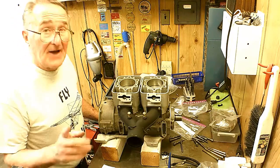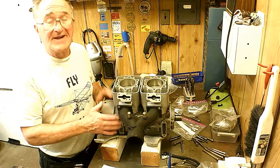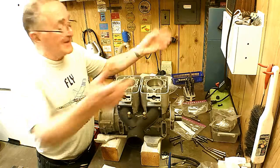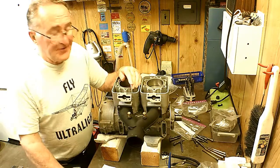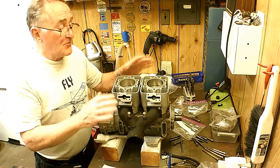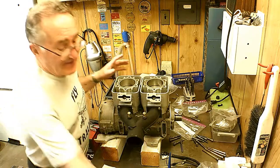The other thing I wanted to tell you, which I think is important, is a guy that owns a two-stroke engine needs to be able to take at least the top end apart. You don't have to take the bottom apart or take the crankshaft out, but you should know how to take these cylinders off because it's real easy. It's a morning's worth of work to decarbonize this thing. I try to mount my ignition coils on the frame of the plane rather than on the engine because it's just faster to have all that off there when you want to decarbonize it. You can't afford to send this whole engine away to have somebody decarbonize it — that's kind of nuts.